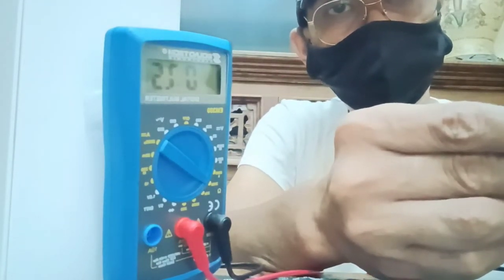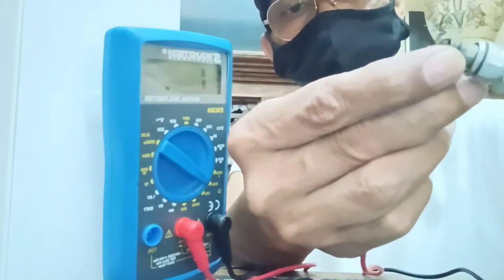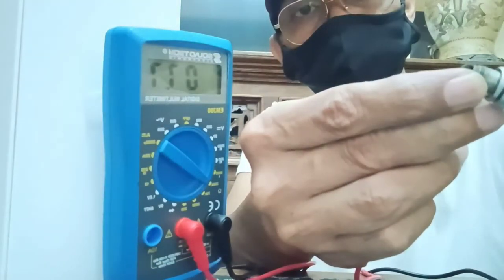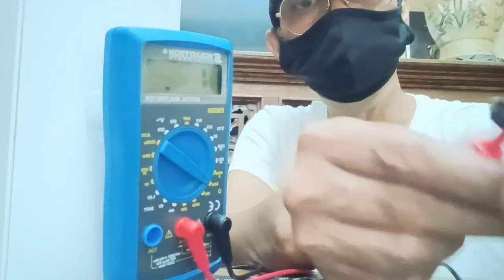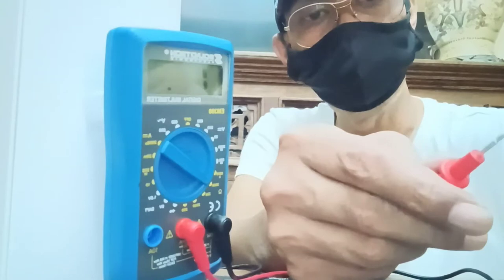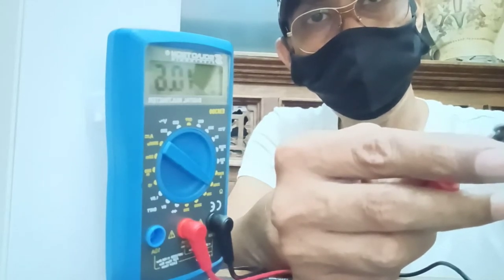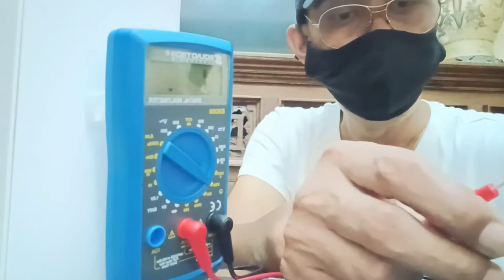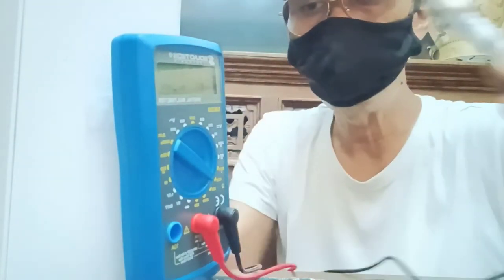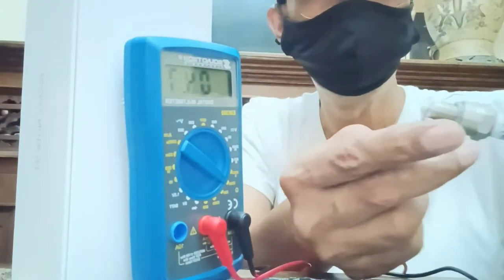It's clean already. You can see 7.6 on the multimeter — it will go. If you touch anywhere on the plug body there is no reading, unless you go over the electrode. That reading is from the copper — that's the reading you need. Now it goes to 10 — but this is without the cap. With the cap fitted, you get 4.5.